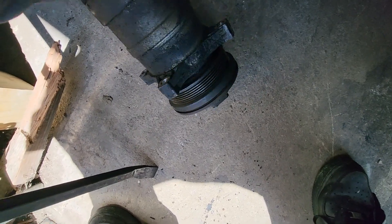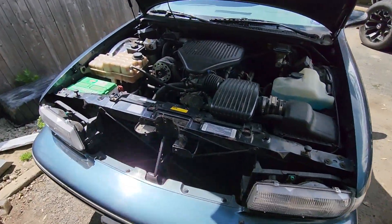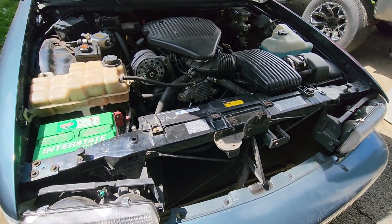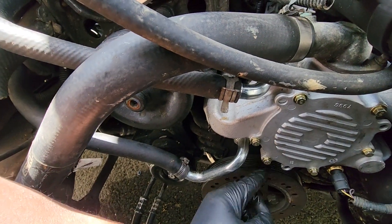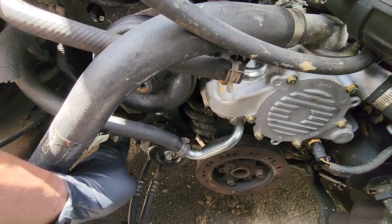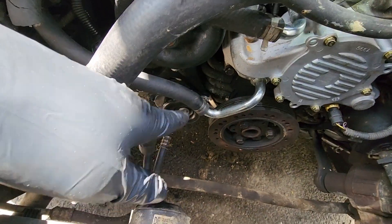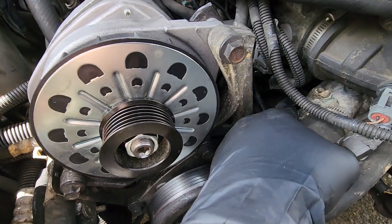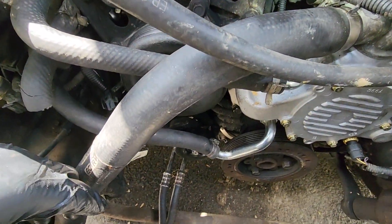There you have it - that was my struggle. As anybody knows with these old vehicles, things kind of snowball. I'm also detecting a little leak here - I'm not sure if it's from the seal. It's dry now but there's a lot of gunk built up down there. Something is either leaking or it was the compressor spilling all over the place. My one mechanic shop told me to check the little o-ring by the water pump, but that entails taking all the cooling components out.